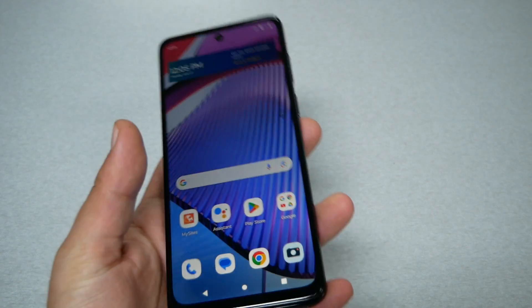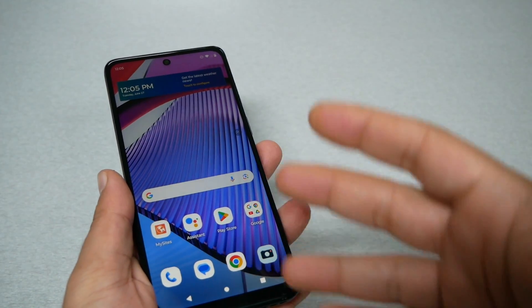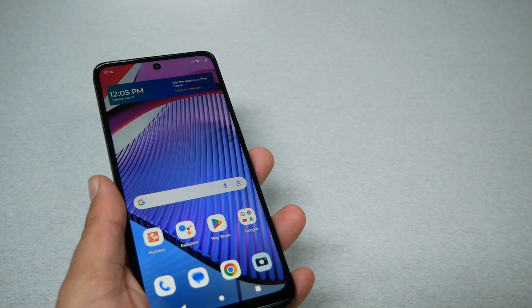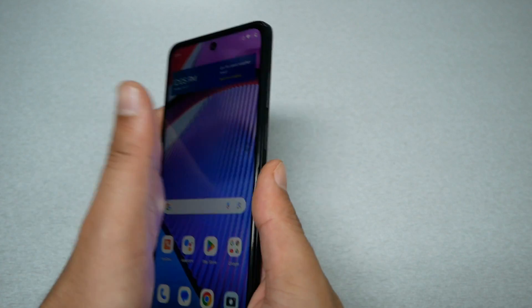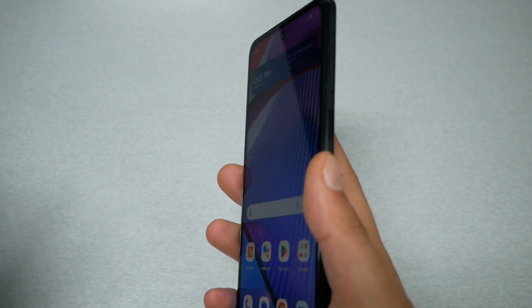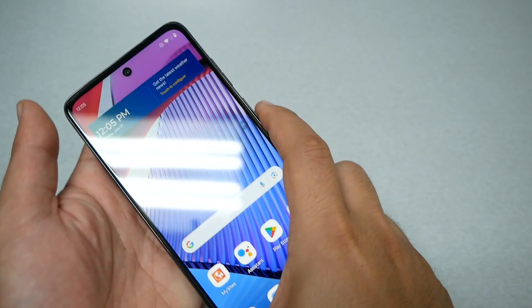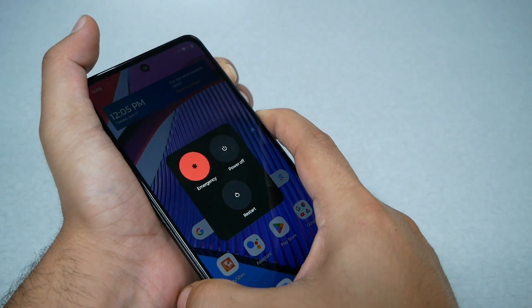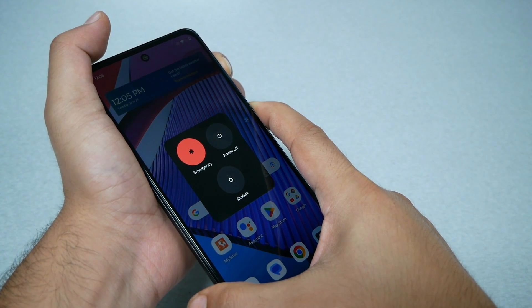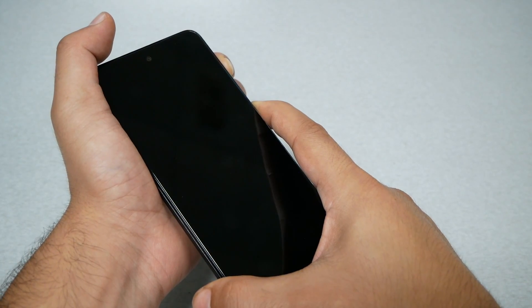I highly recommend doing the following: first, put the phone on the charger in case the battery was not charged — that may be why your phone doesn't work. Make sure your phone is fully charged. Then, if you believe your phone is charged up, press and hold together at the same time the power and volume up buttons. If the phone has a black screen, hold for at least 10 seconds and don't let go — just hold.